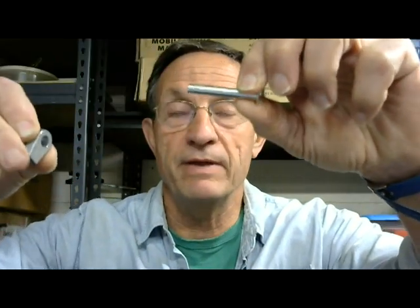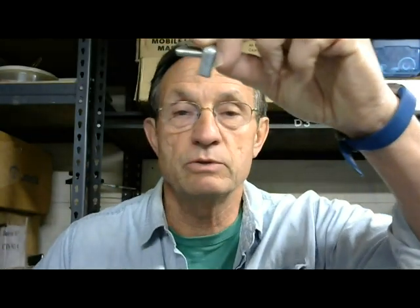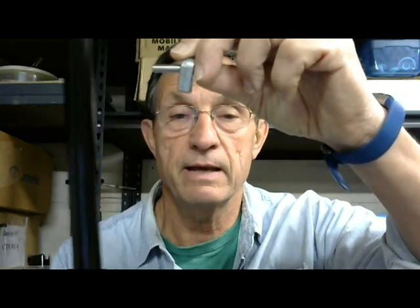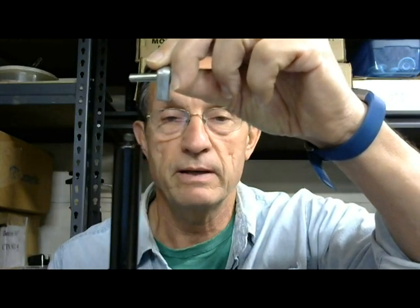There was a good reason why it didn't have the eyelet — you really didn't need it. What a customer figured out and shared with me, and I thought it'd be worthwhile to share with you, is that you don't necessarily have to take the old eyelet off the awning. Typically it comes with a rivet, the eyelet goes into there, and the strut goes into there. What he figured out was that you could just rotate this thing — you can see it going around — unscrew it, and essentially you won't have to take the rivet out. It makes for a lot easier and cleaner job.